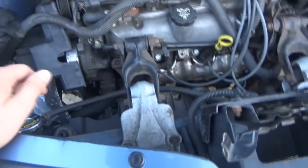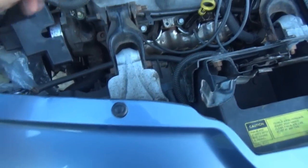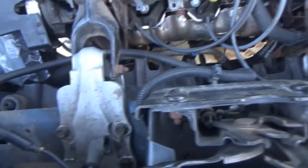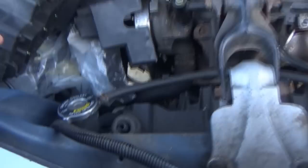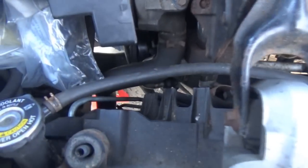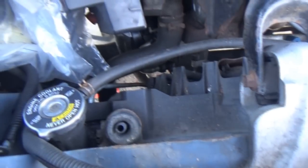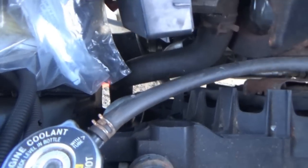What else do we have to do to get the radiator out? These dog bone mounts are going to have to come off, which I've had those off numerous times already. We'll have to unhook some hoses. To drain the radiator, I think all I'm going to do is take the lower radiator hose off - right here. Maybe I'll have to do it from that side there. So we'll tear it off from the bottom with the radiator drain up that way.